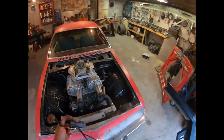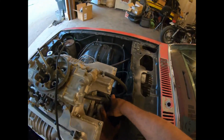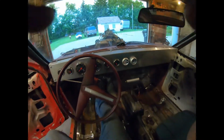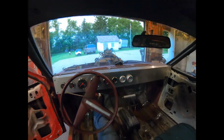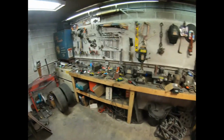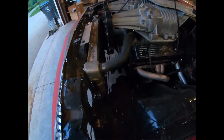Let's time this thing. All right. Well, I think I got the distributor cranked down pretty hard. Well, that may have moved anyway during the abuse I put it through. So let's fire this thing up and see what she does. All right, I gotta mark zero on that balancer, I'm sorry, on the timing tab, because I can't see it. All right, so 480. All right, there we go. All right, fire it up again.